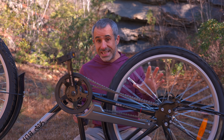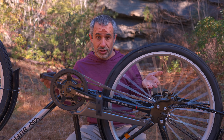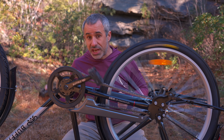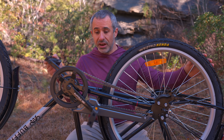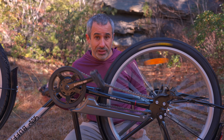You can see back here at this freewheel mechanism, there are actually two cogs. When you kick the pedals back, it's engaging or disengaging the outer cog — that's the higher gear. If we disengage that higher gear by kicking the pedals back, now the lower gear drives the bike, and that gear just kind of sits there doing nothing. You still see the chain move. Switch it back to the higher gear, and now it drives the bike, essentially running circles around the lower gear.